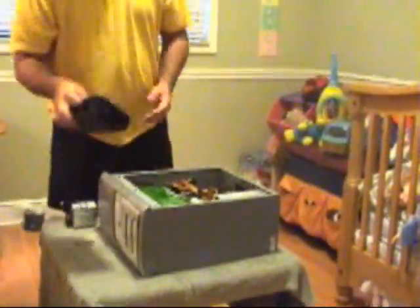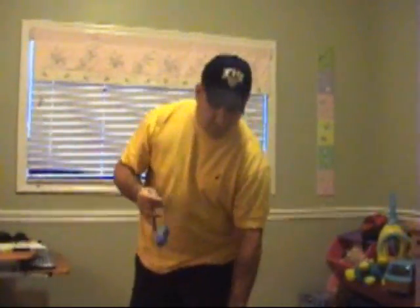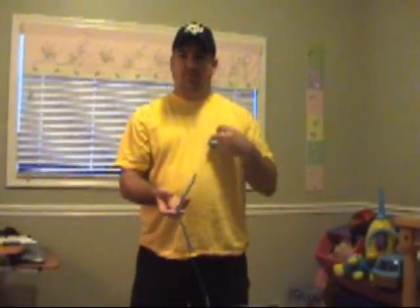Okay, here is a standard PC kit that you can get. Toolkit. It's not very expensive. They range anywhere from $10 to $15, and with it you'll find all types of screws. You'll find some additional tools, but more importantly, what you're going to need for this particular project is your safety strap. The safety strap, as I said in the beginning, will prevent you from shorting out your motherboard.